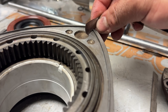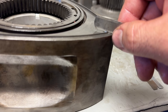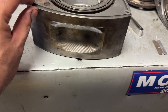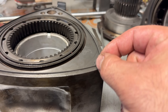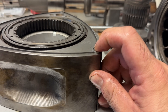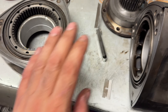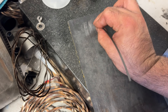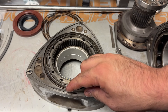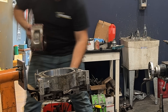Right there. Same thing. Now this one is too tight, it won't go in. Even though it goes into the slot, you can't use it. Because when heat expands the side seal, it starts pushing outwards and it pinches the corner seals. See it's moving the side seal — the side seal is too tight. We need two-thousandths clearance on the side seal, so we're going to keep going at it. Remove it, go on a flat piece of granite or glass, whatever you have, with some 400-grit sandpaper, and keep going back and forth until you get the clearance that you need.